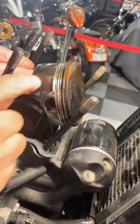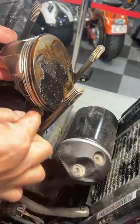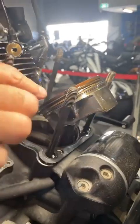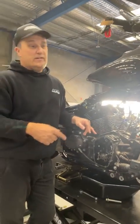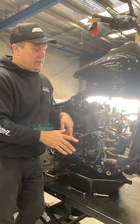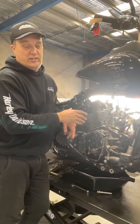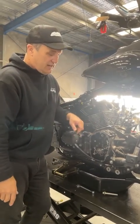This is probably how the standard map sits on this bike — we haven't tuned it. But when you see one of our bikes tuned, you won't see that wear on the skirt. The wear on the skirt is from pre-ignition and the piston rocking around. It's quite bad on the front cylinder. The front cylinder on a V-twin Harley does 70% more of the work than the rear — that's with all V-twins. You have to understand what's going on with each cylinder when you're tuning it, which is why you need to know these engines before you go in the dyno room.